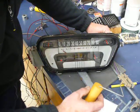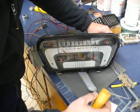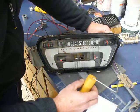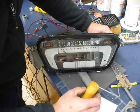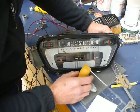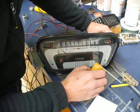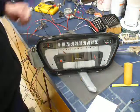On the range of this thing, the bottom quarter is going to travel pretty fast — that's only about an inch and a half of arm travel. Quarter to half is a couple inches, and the top end means three-quarter to full is going to cover about half the tank's range. Anyway, it's better than a stick down the filler hole.